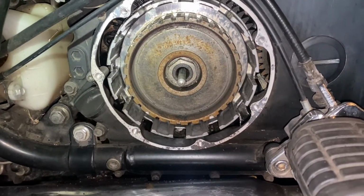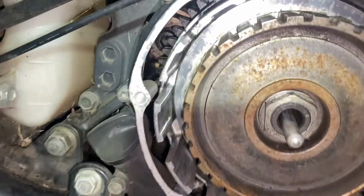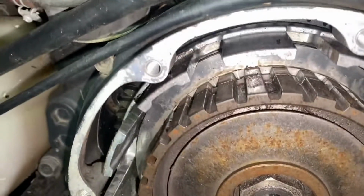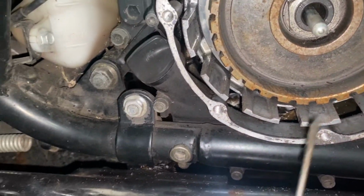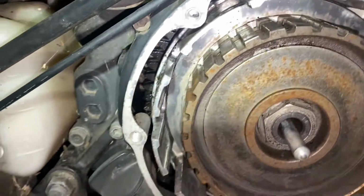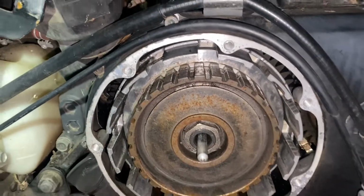So the problem we have with this sitting open for so long and collecting water, I'm sure dirt's gonna get in here. I feel like a dentist getting tartar, but I've been scraping dirt out of the bottom here, and there was junk. I'll show you here, there's dirt up and around here. Now, my first thought is I can blow this out, but that's probably just gonna blow it into the engine, and I don't really want dirt in my engine. So at this point, I think what we're gonna do is wipe up anything I can, try to get that out without getting it down the engine, and get as much dirt as I can just by picking it out. And then I think what we'll do is, not using a gasket, but we'll put a cover on this and refill it with oil.